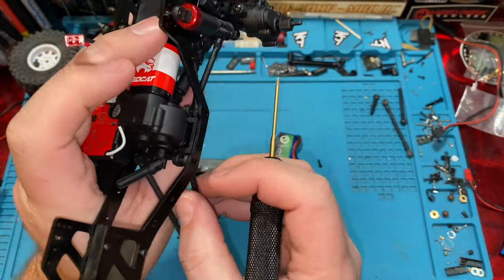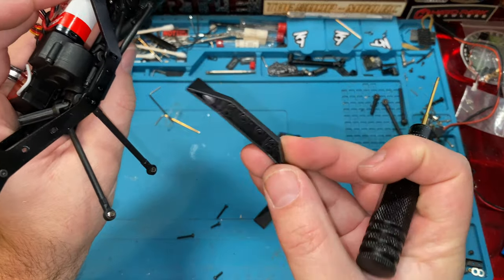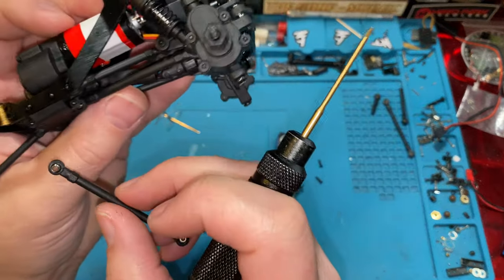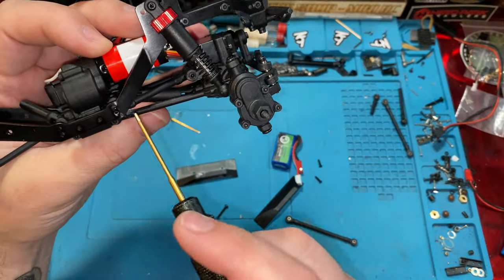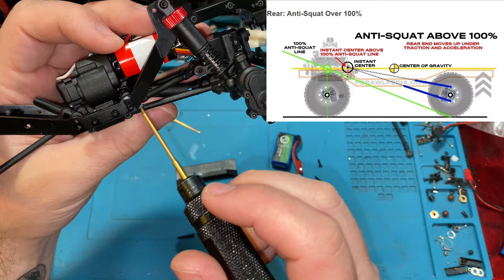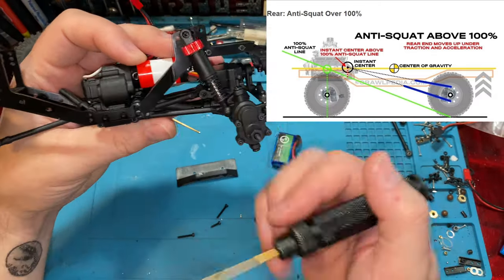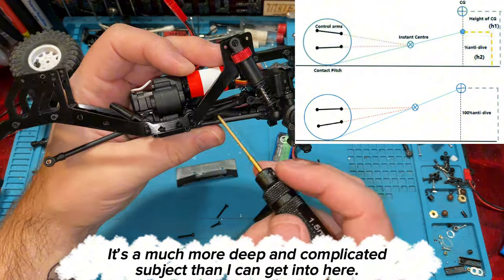So that's cool that straight out of the box, stock, you've got some different link mounting options. We really dig that. Built into the chassis and the skid and the sliders. So definitely cool that it's adjustable there. That'll generally help with your anti-dive or your anti-squat, getting them separated. Separating your lower and upper links more helps the geometry for hardcore climbing.